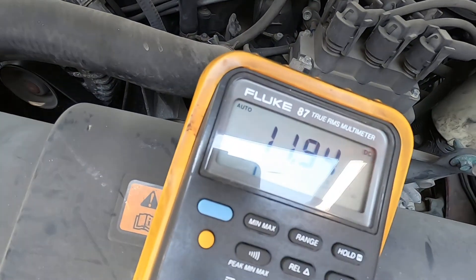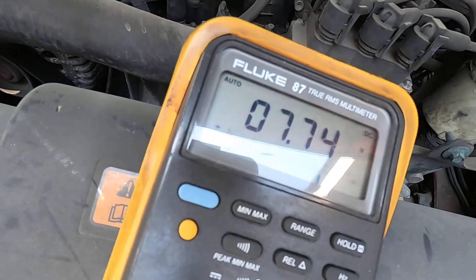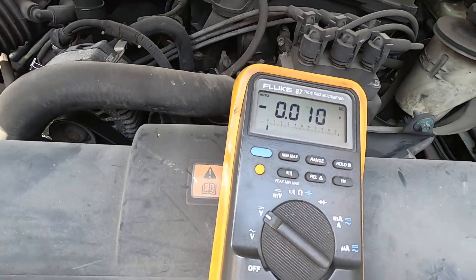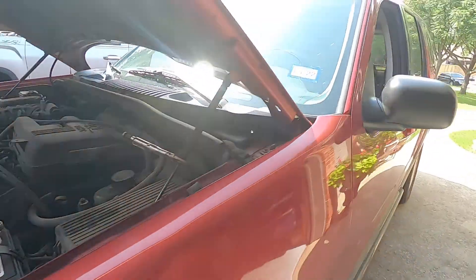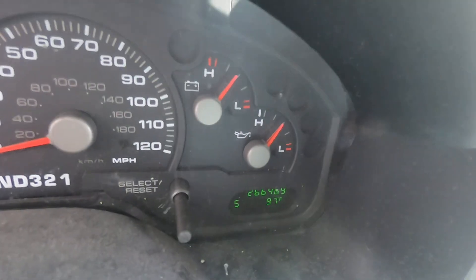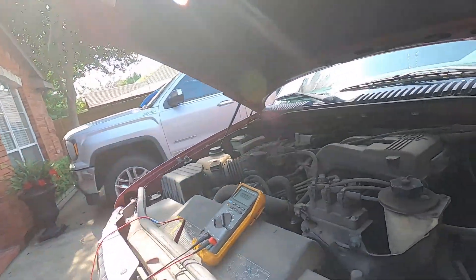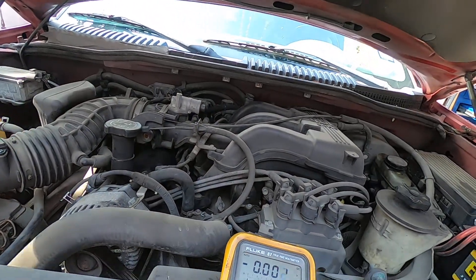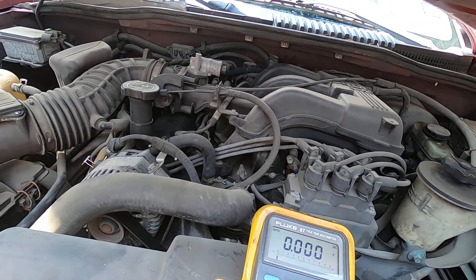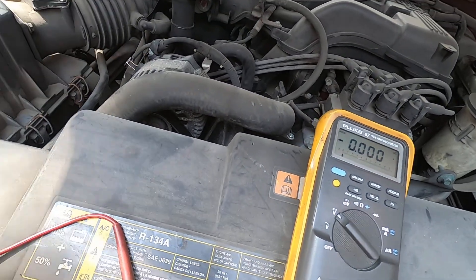Going to the orange wire, which ultimately ends up at the battery, and then the PCM wire — 8 to 10 is what the book shows. It might be 7.75 because the battery is low. Either way, the weird thing to me is why we don't have a battery light. We still have no battery light. That's strange. Definitely something Ford needs to work on, because if that battery light had come on, she probably could have at least pulled over or started turning stuff off. She still had her AC going. So I've got to put an alternator on this vehicle.